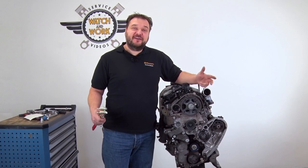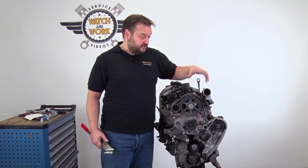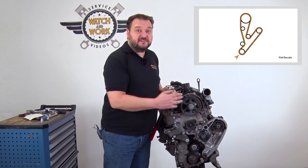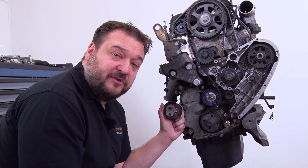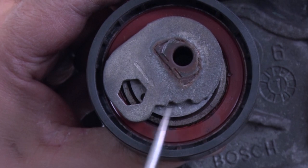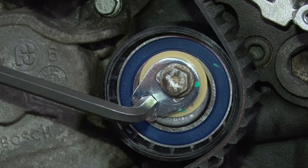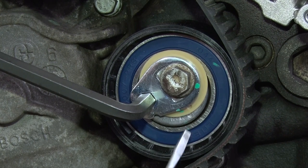You've now changed the components from the kit. Before fitting the timing belt, you have to slacken the camshaft sprocket using the counter hold. You can now start to fit the timing belt counterclockwise, beginning at the crankshaft sprocket. Pay attention when fitting the tensioning pulley — the new tensioning pulley looks different and is fitted differently. You tension the tensioning pulley counterclockwise via the hexagon socket until the recess completely covers the bore.